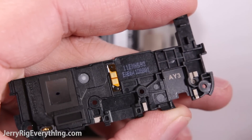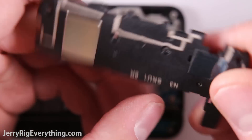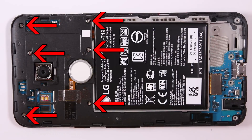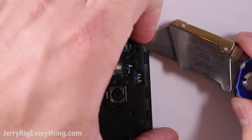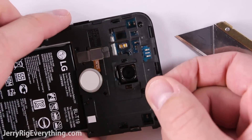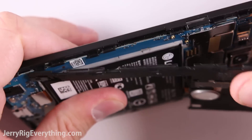This is actually the loudspeaker of the phone — you can see the two contact points down here at the bottom. I will link replacement parts in the video description below as well. There are six screws along the top. I used a razor blade to start the top corner, just lift it up a little bit, and then unsnap the rest of the back plastic piece off the phone.